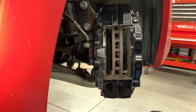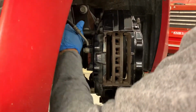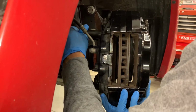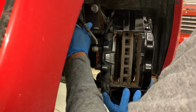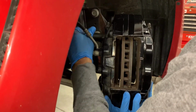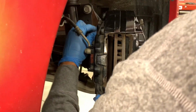Now you guys up north, these bolts can be pesky because they get a lot of corrosion. That's a steel bolt into aluminum caliper. Be careful with that. You can pull the threads out of the caliper. You've probably seen that or heard of that before. Some PB Blaster or et cetera beforehand is not the worst idea if it's been years and or you got a lot of salt and rust. We'll take a close look at that again in a moment when we have everything off.